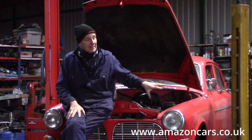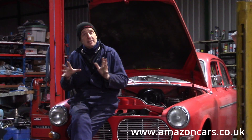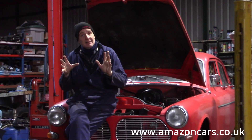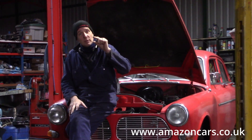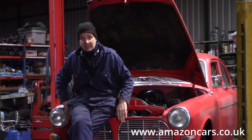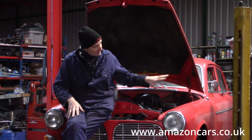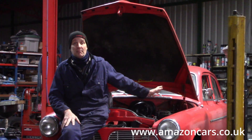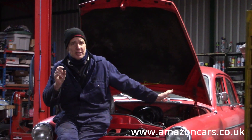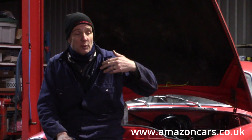We've fitted what we call road rally or fast road springs. Those are a nice compromise between comfort and sporting, and because they're 20mm lowered, the whole car's centre of gravity is just a little bit lower. It's difficult to tell by eye — there aren't many people who could detect this is a lowered car — but that 20mm makes a big difference in the way the car handles. We've been going through the brakes; the rear drums were getting thin. The spec limit on rear drums is a maximum internal diameter of 230mm — this was about 229mm — and as you approach 230mm the brake drums get hot very quickly, so braking efficiency falls through the floor.